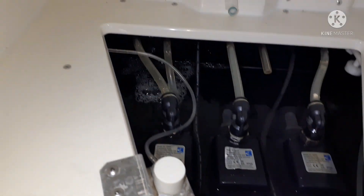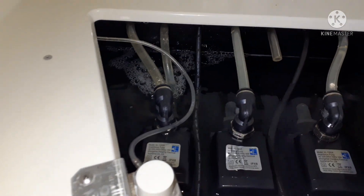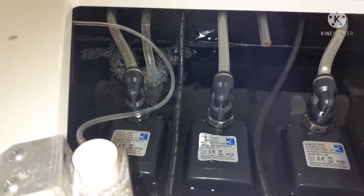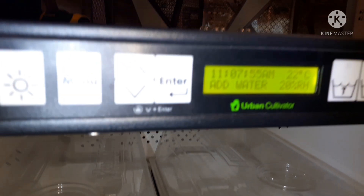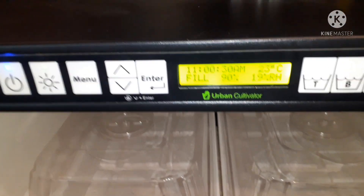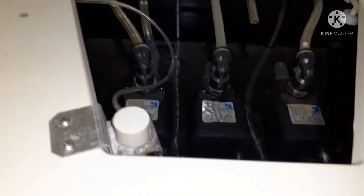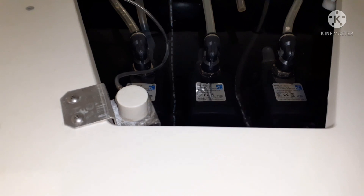Checking some other active components of the machine to make sure it is working properly. We are checking for the filling of the water to make sure it is filling or not. I think it is not filling, so we have an input problem or output problem in the PCB.